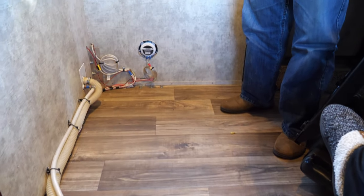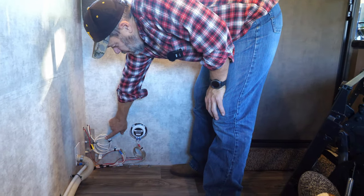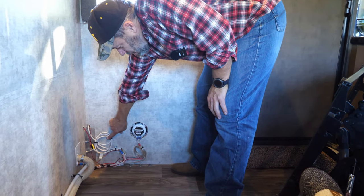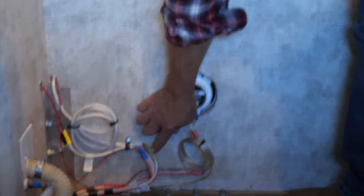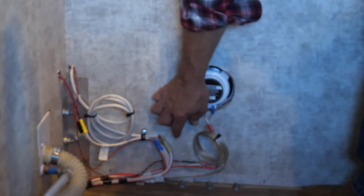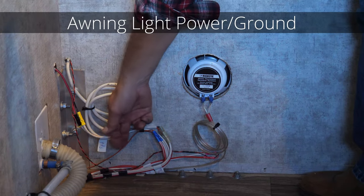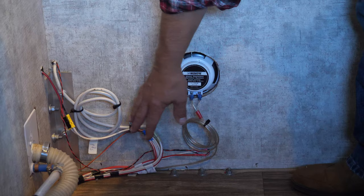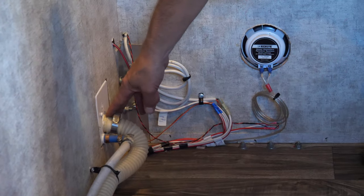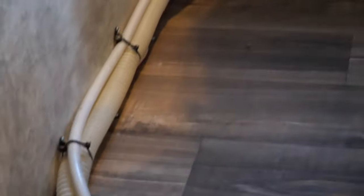For anyone interested in what's going on underneath a Cascade, these are your awning wires for your awning motor. I've had several of those yellow crimp connectors come off, so my awning motor stopped — I put in new connectors there. These little wires are the awning wires, and these are the lights that go underneath the coach. And then your speaker wire, your water inlet, your fresh tank inlets, and your breather tube are all connected down there.